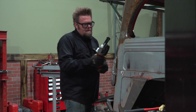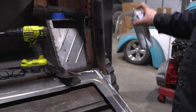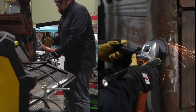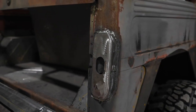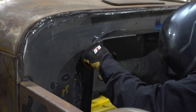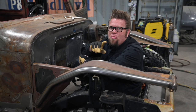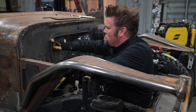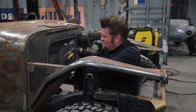Before I finish-weld it onto the body, I'm going to remove the bracket from the back of the wagon, grind all the rust off, put on some weld-through primer, and then weld it in place. The round bar here is simply to dress up this opening — classic cars like this didn't have hard turns, so it makes a nice smooth transition off the firewall into this step-back spot. With that, pretty much all the sheet metal work is officially done, so the body comes off the frame to turn it upside down and work on the floor.